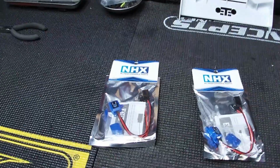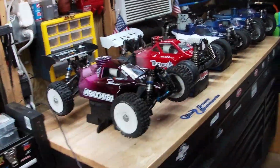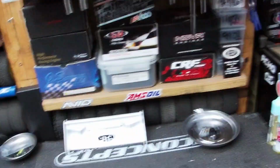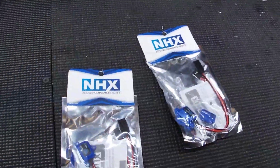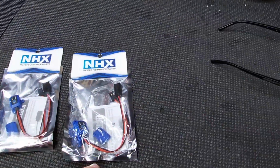You guys know that usually I use the Sky RC electronic switches. I've been using a few just mechanical switches, and they work fine, but they wear over time and get corroded. But these go out too. So, you know, the only thing when you're bashing is you can knock your power switch off and have a runaway. That's the main reason we all go to electronic switches. These are also LiPo compatible or nickel metal hydride, your NiMH battery.